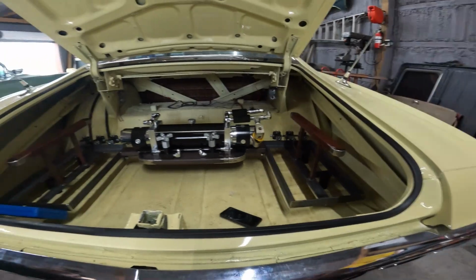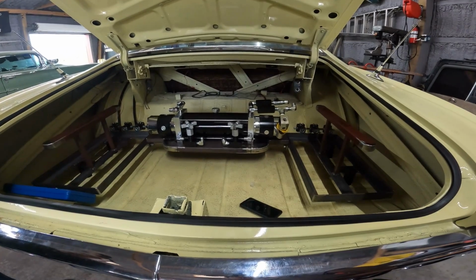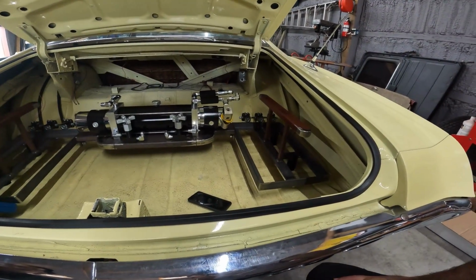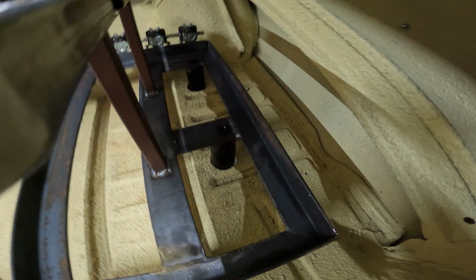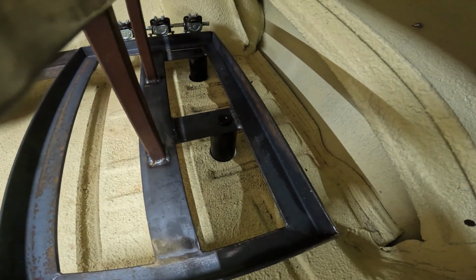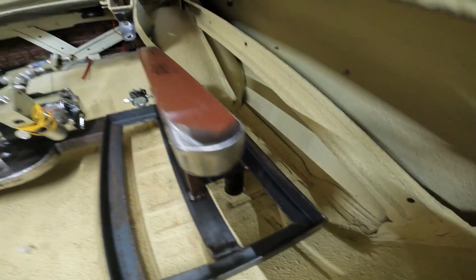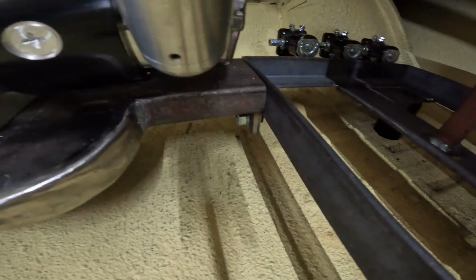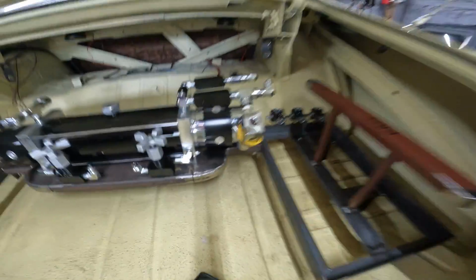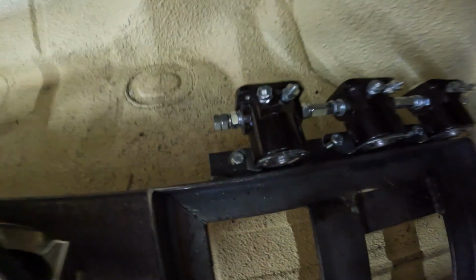But I mean, once we're done with all this fabrication stuff, roll it out. Wash it out, yeah. So the rack is completely bolted in from the uprights with some countersunk flathead bolts. Some 1/4 inch flat bar holds that, and the whole pump stand also bolts into the battery racks with some 1/2 inch bolts, 2 on each side, so it won't teeter totter. The solenoids are also bolt in. We drilled holes and then welded little nuts on the underside.